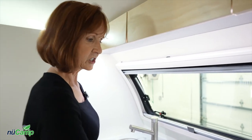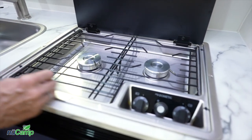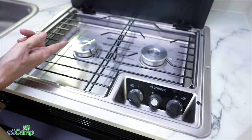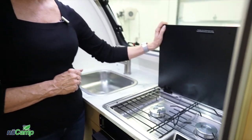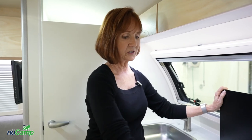Just inside, you'll see the kitchen on your right. Let's start with the two-burner glass top stove — just lift the glass top cover. To light the burners, take the first knob, push in and turn it to light. Once you have gas coming out of the burner, push the sparker in the middle. You may have to push it more than once to get the burner to light. Once it lights, adjust the knob to the desired flame height between high and low. When you're done, turn off the burner and be sure to let it cool off before you lower the glass top.